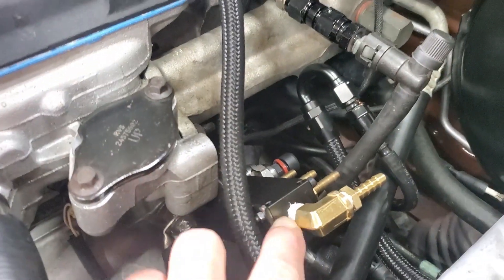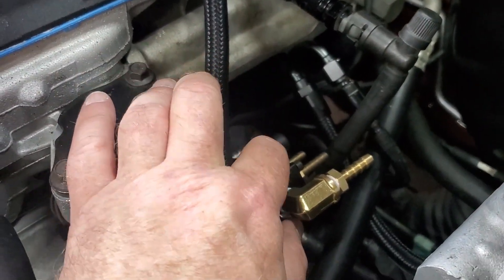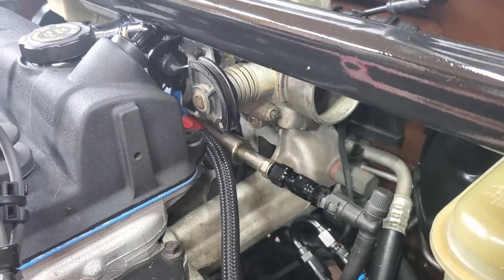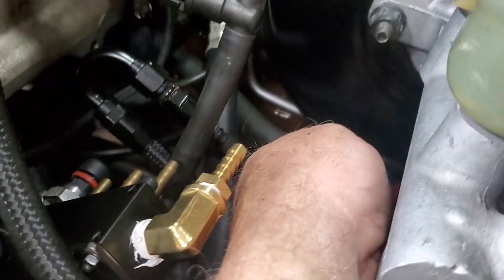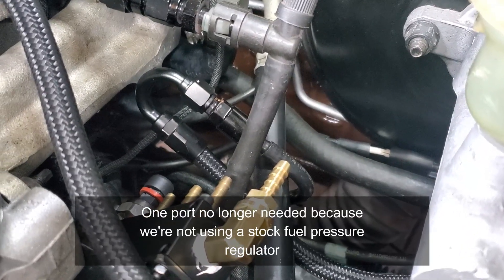The little block here, I've got it mounted kind of loosely. I did check to make sure it would clear the throttle body and make sure it clears when the engine moves — everything is clearing. Down here, that silver fitting right there is going to tee into the brake booster line that's right here, but further on down so it would be more of a straight shot.